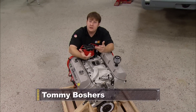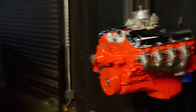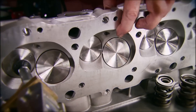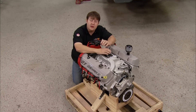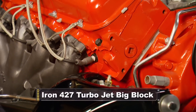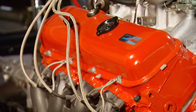The 427 cubic inch Z11 was the drag racing counterpart to the 409. The next generation of Chevy big blocks, dubbed the Mark 4 Series, is a spin-off of the old W blocks, with the blocks now being milled at the conventional 90 degrees, and the chamber and valve placement being altered to improve performance at higher RPM. That valve placement is where the old nickname came from — the porcupine. In 1966, the Mark 4 version of the 427 was introduced, and it's still considered one of Chevrolet's most successful and versatile engines.